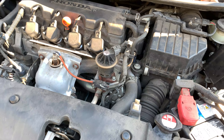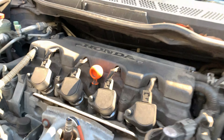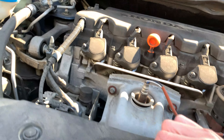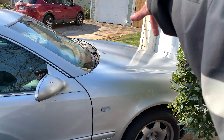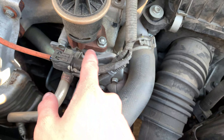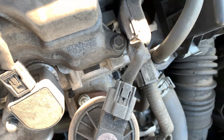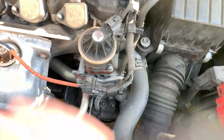Just for reference, here's the EGR valve on a Honda 1.8 liter. The front of the engine is this way — this is a transversely mounted engine because it's front wheel drive, so the belt and everything is on this side. On the Mercedes it was on the front of the engine because the engine mounts longitudinally — it's rear wheel drive. On the Honda, you have a bolt there easy to get to, another bolt a little tighter but still easy, and one electrical connection, and the whole thing comes right out — you don't have to move anything else.